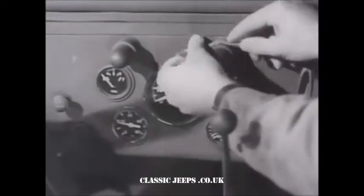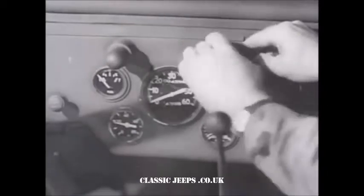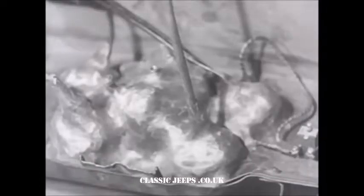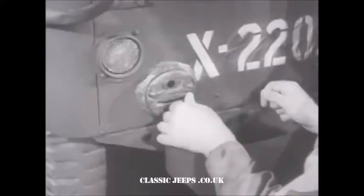The Jeep's dash panel is next, and the driver proceeds to waterproof the panel lights by working a strip of AWC around them. This same care must be observed when waterproofing all the vulnerable parts that would be affected or corroded by the action of the salt water. In every case, the AWC is carefully worked in so that the compound tapers to an edge, forming a waterproof seal. This is true whether the part covered is a gear housing, a starter motor, the carburetor, a tail light, or an electrical connection. All must have the same thorough attention, for it must be remembered that seawater will quickly rot and destroy parts. And parts are hard to replace, especially on an invaded shore.